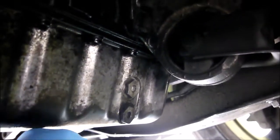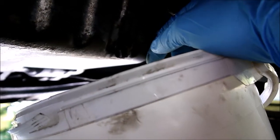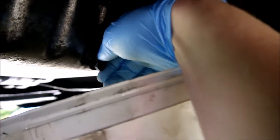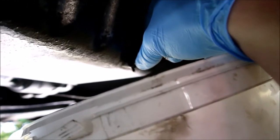Right, now that's coming loose. I'm going to stick my bucket back underneath. I'm going to unscrew it, and as I unscrew this I'm going to keep it pushed in so that the oil doesn't fire out all over me, and also so I don't drop the sump plug into the bucket. I'm going to keep it pushed into the engine — you'll start to see a bit of oil dribble out — keeping it pushed in until the very last moment when I can feel the clicking of the thread, and I'll whip it away in a heartbeat. I can feel the oil dribbling out now, and the oil should start to flow. I've kept hold of the sump plug nut which I'll put to one side.